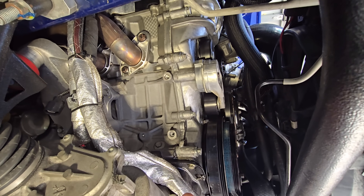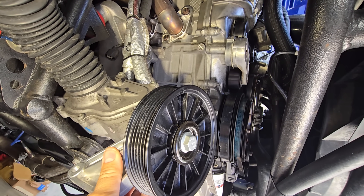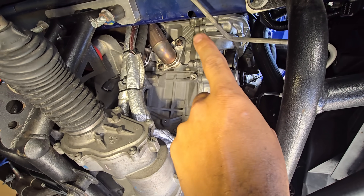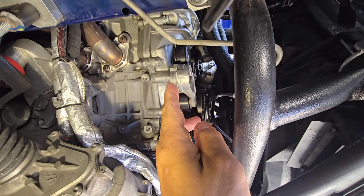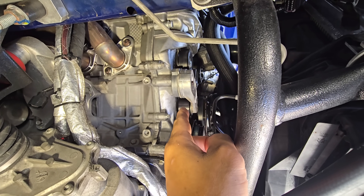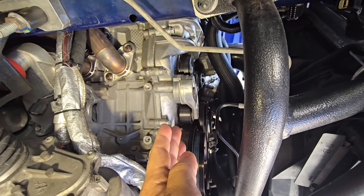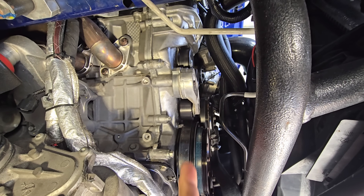The thought process is: if you add a pulley — like a delete kit or an idler kit — it'll make the belt come this way more so it can wrap around the AC pulley or the delete pulley. That causes the belt to come back more, wrapping around the AC pulley and automatically giving the tensioner pulley more belt wrap so it can keep proper tension on the belt.